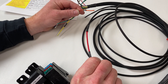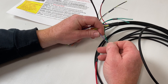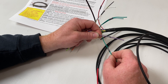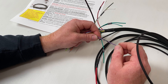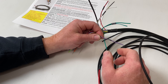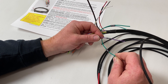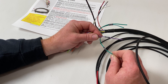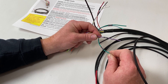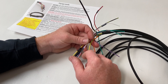We've got an AC relay and AC switch — these are a little more in depth and depend on what type of ECU you're running. On most JDM applications, the AC switch will be a ground input going to the ECU. The ECU will then allow permission, which goes out to your AC relay. Keep in mind the AC system relay has to have a secondary safety — it needs to go through pressure switches so you can't over-pressurize the system and potentially damage or explode the AC compressor.